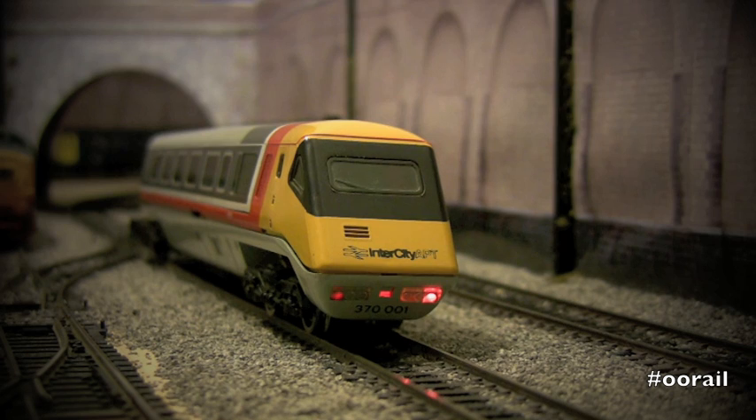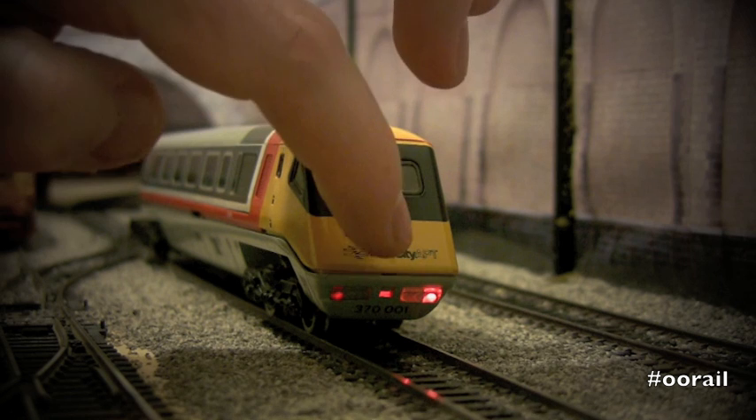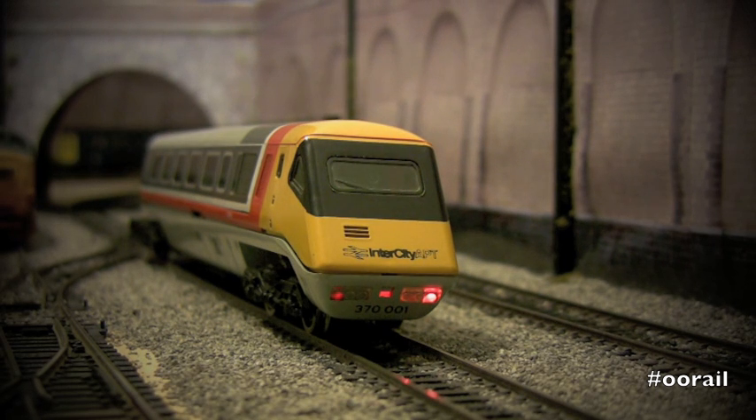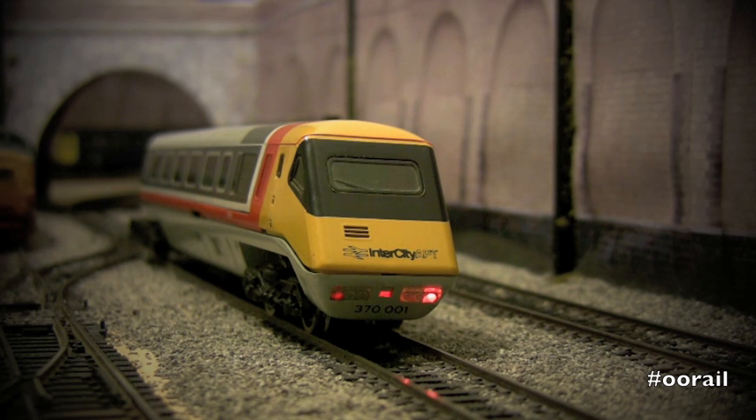One thing to point out — you can see there's a bit of light pollution coming out through the center. That's because the housing isn't completely pushed all the way down. If you get that and it's still a problem, you can just use a bit of masking tape on the back end of that connector clip that goes in there, and that will fix that particular problem.